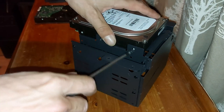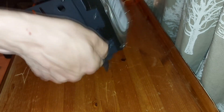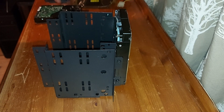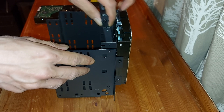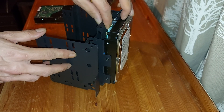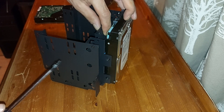It is quite nice to have that additional security for your data. That's our parity disk installed, and now it's time to install our SSD which is going to be used as our cache drive. A disk cache is a mechanism for improving the time it takes to read from or write to a hard disk. A disk cache can also be a specified portion of RAM. The disk cache holds data that has recently been read and in some cases adjacent data areas that are likely to be accessed next.